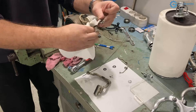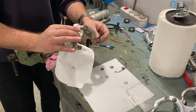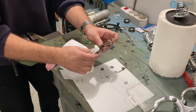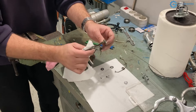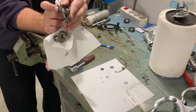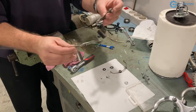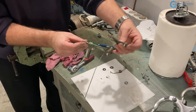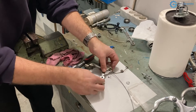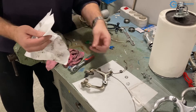It has three washers, just like the small washers you can see here — those are from the original old brake. Here I'm just cleaning it up before assembling. If you're not sure how to reassemble, it's usually possible to put it only one way: the cable stop must align right below where the cable is tightened. If you try to put it any other way, those two won't be aligned. Also, if you put the calipers the wrong way around they won't fit — the shape forces correct orientation — they'll slide and be perfectly aligned only when placed correctly.